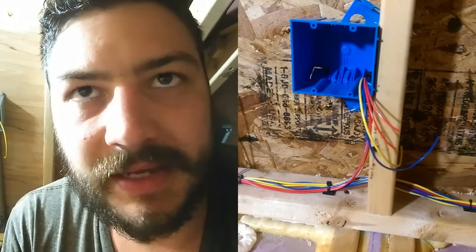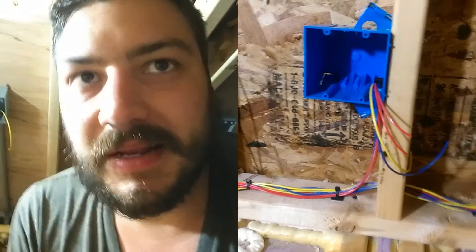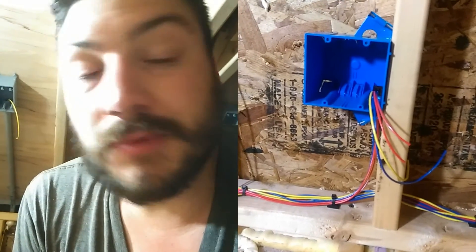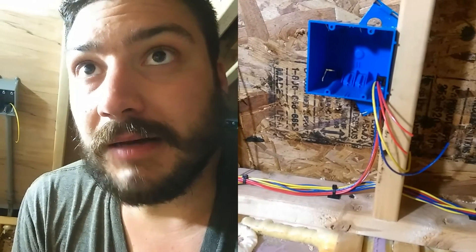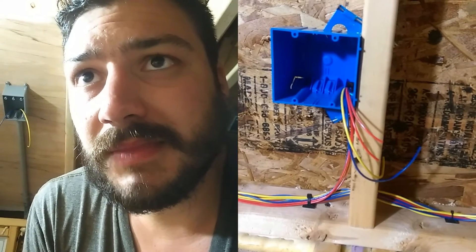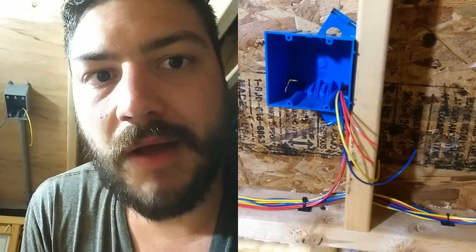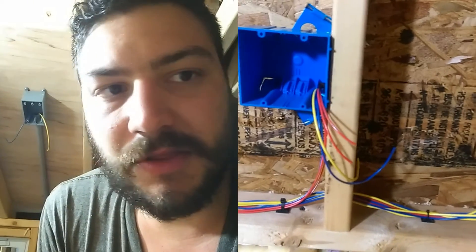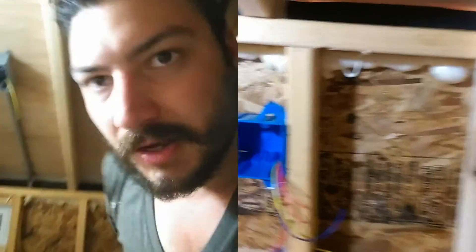I'm not using solid copper wire because that will possibly vibrate loose over time. I'm using fixed connections. As you can see, this blue box is basically a normal electrical box. When you build a house that sits in the back of a truck, code kind of goes out the window, but this is plenty safe. I'm using a basic color scheme: blue as DC ground, yellow as 12-volt DC supply, red is used in three-way switches, and in some instances I use the color codes of the device.